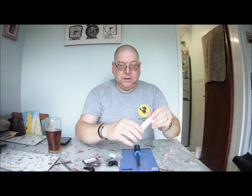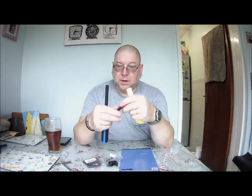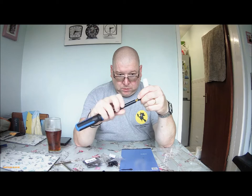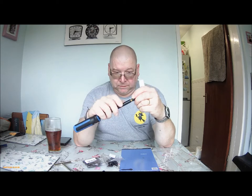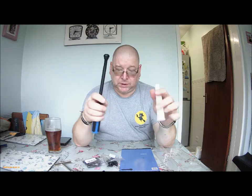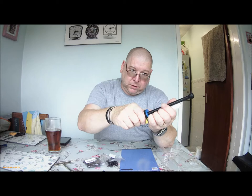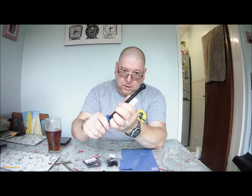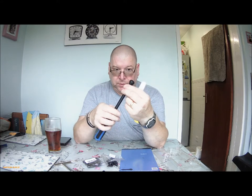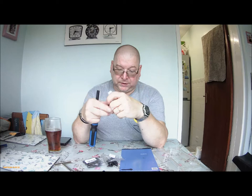You'll see, dead easy. You've got a tool for guiding it in, and you've got that tool. It just screws in onto the valve, like so. Lubricate it up. I just used a bit of washing up liquid. You push that onto the wheel, push that, ram it in. It'll go all the way in. And then you pull it back and seat it fully on the wheel rim. Unscrew it. Put the valve in. Sorted.